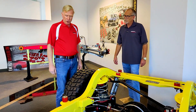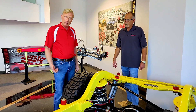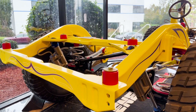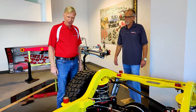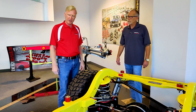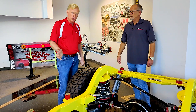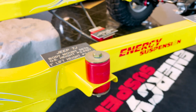They will also degrade due to the weather — they may become checked, brittle, and cracked from environmental failure. And once one of the body mounts degrades, it overloads neighboring body mounts, intensifying their failure and spreading that failure across the entire vehicle. You'll notice the body swaying when driving, feeling unstable because the body is shifting on the frame.